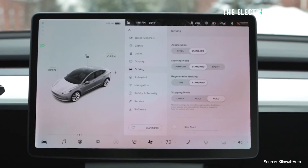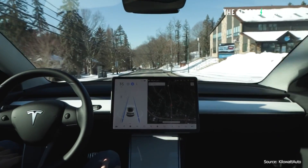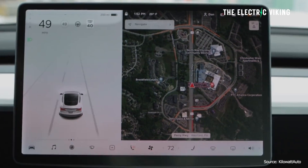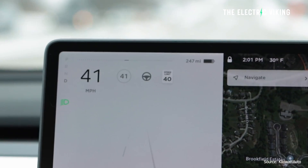When the battery is nearly fully charged, the feature doesn't work properly. You'll go to brake by lifting your foot off the accelerator, and that will naturally brake for you because your regen is turned on. But when your battery is nearly full, it's a weird experience where the battery can't actually take on any more charge, so the braking feels different to normal.